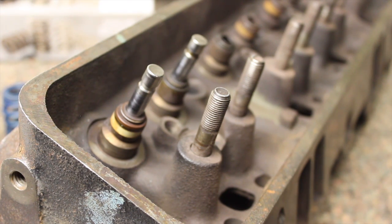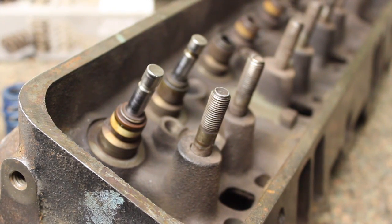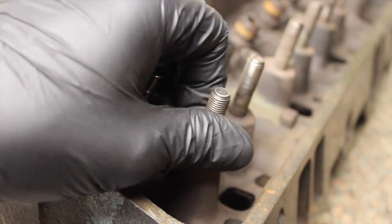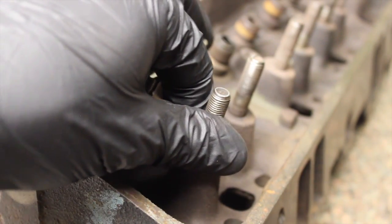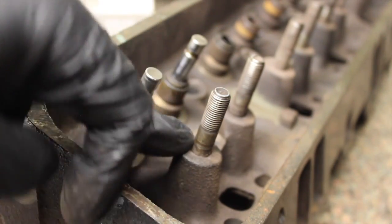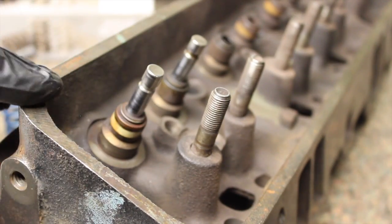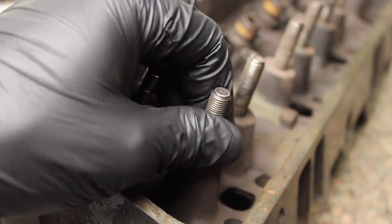I'll show you how to do it — it's pretty easy. The hardest part is pulling the old ones out; some come out easy and some are stubborn. It's not something you want to risk. If you're running around 480 thou lift, not crazy duration, not revving it hard, you're probably okay with the press-in studs — but that's a risk you have to decide on. While you have the heads off anyway, you might as well pull them and upgrade. You can do it yourself at home. Sending them in for guide plate machining is another option — rocker arms are cheaper if you go non-self-aligning, and it's always recommended especially with heavier springs.